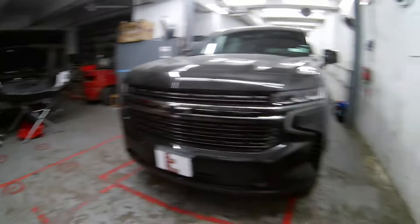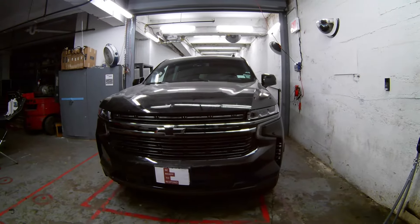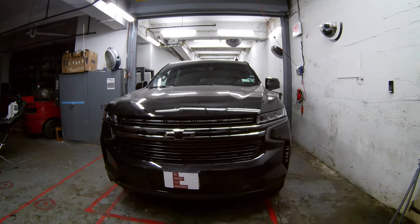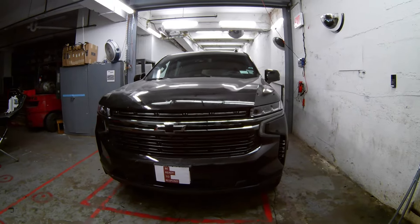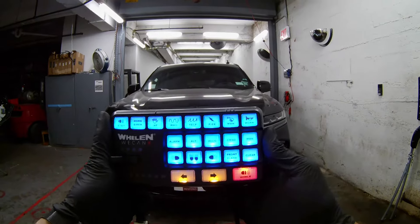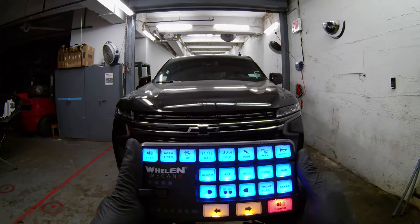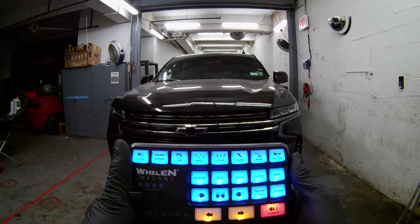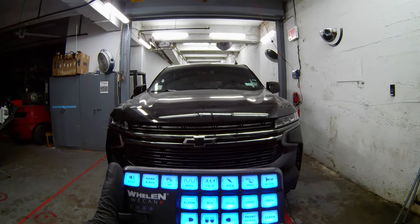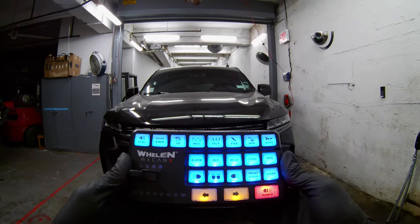This install is done in two stages. Some of the components are custom-made by Whelen and we're waiting for them to arrive. In the interim, we did a Stage 1 install with most of the parts, and we'll complete the final stage when the remaining parts come in. This is a tri-color configuration. The vehicle operators will use it in a red/white mode for the front and red/blue in the back, a blue/white mode, and a white-only mode, cycling through the slide switches.